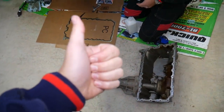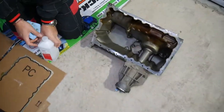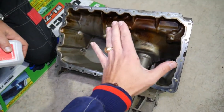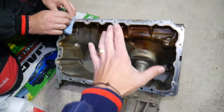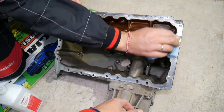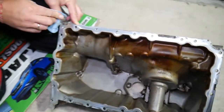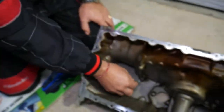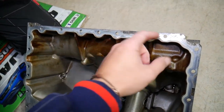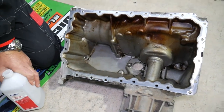About diagnostics, electronics, fixing engine codes, things like that. So what are the possibilities now? This is an oil pan. Some oil pans do not have a gasket at all. Most of the time when you have an aluminum oil pan they will not have a gasket — it will be just the aluminum pan. And not just aluminum; sometimes even metal pans don't have a gasket. In that case there is a silicone — a gray silicone, high-temp gray silicone — and it's applied on the inside of the bolt, stuck to the engine. Some of them will have a gasket like this one.